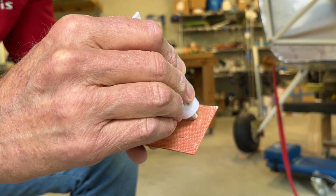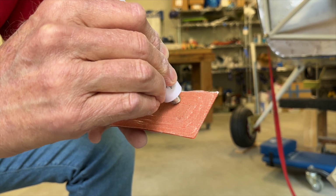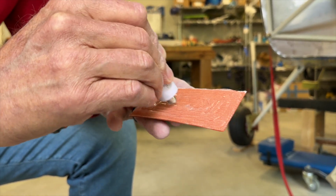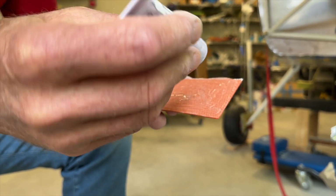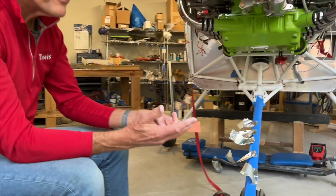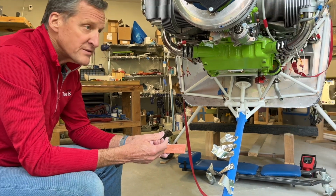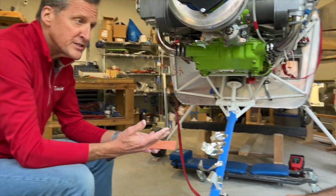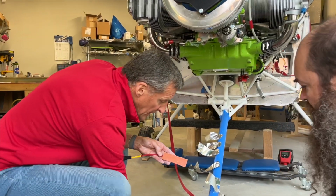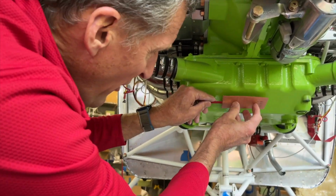You essentially just need about the thickness of a safety wire, like 32 thousandths, 20 thousandths fine safety wire. You just put enough on here to cover the entire pad. Some fun stuff with this is that it actually will cure underwater. The curing process needs moisture, so humidity in the air, and temperature. Once we've got that and we know we've got all the pad covered, and we have a nice flat surface with this one, it's going to be a real simple process.